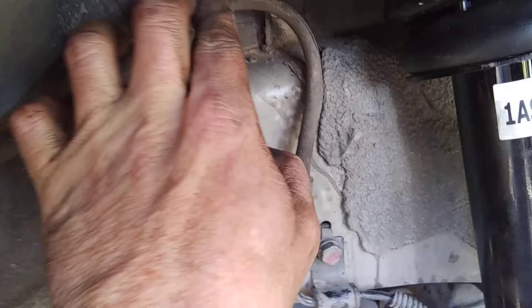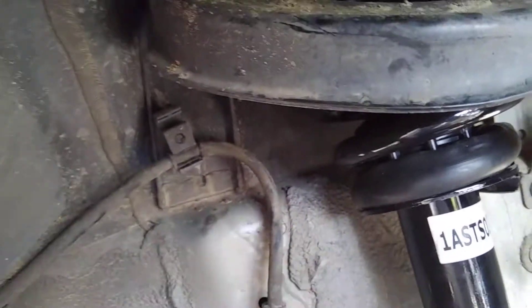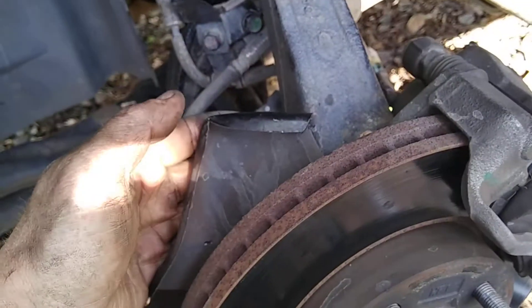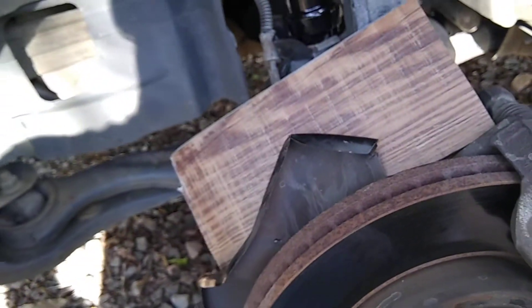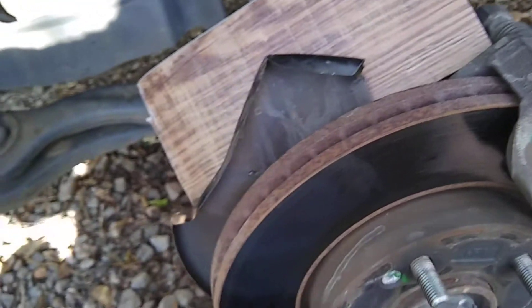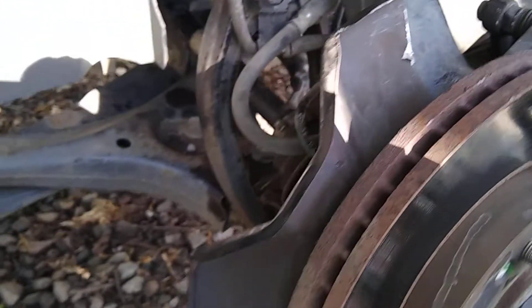This just gets pushed back — it comes loose on you because when you took everything off it just pops right back in there, just like that. Now, if you accidentally bent this while you were trying to pry it up, there's an easy solution — don't panic. Get a thin piece of board and lay it back here; I'm going to use a piece of flooring. One hand prises up while you take a body hammer — or any type of hammer, preferably something like this — and you just hit in here to get that flattened out. And there you go, bent right back into shape. That's the way it's supposed to look.